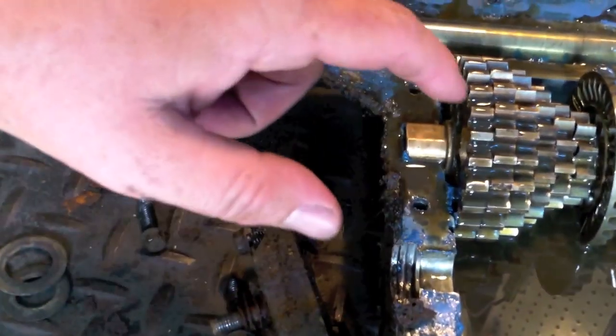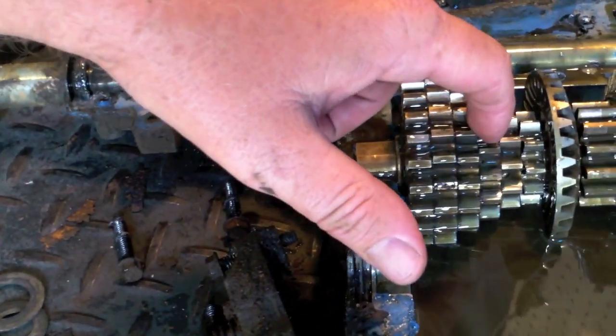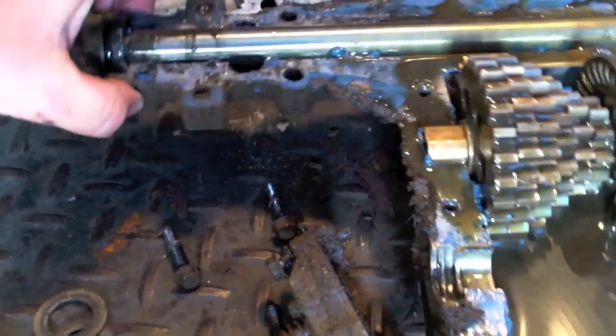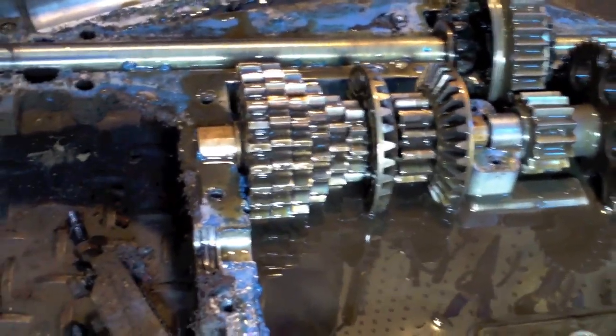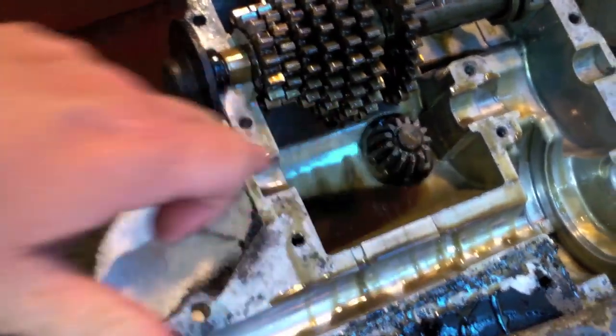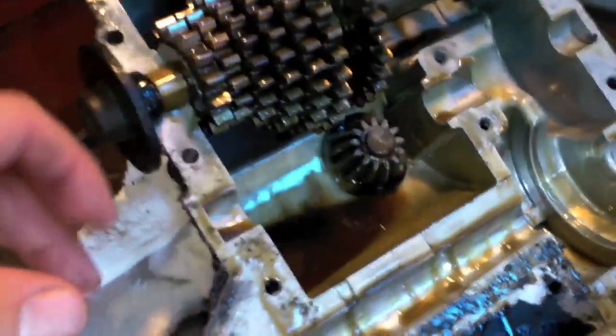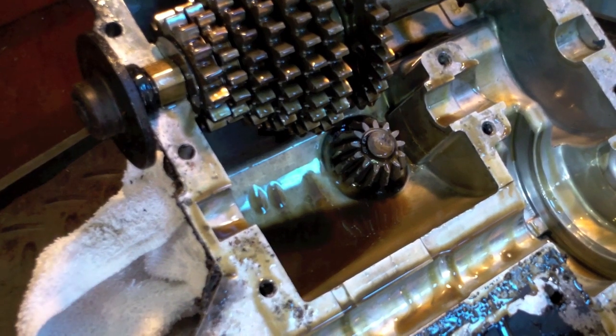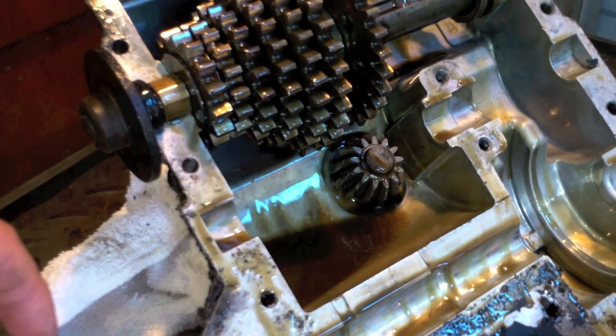And this is indeed 1, 2, 3, 4, 5, 6, a 6-speed, because that's critical, because the rear transaxle in the Murray Gator is a 6-speed as well. So I've got to have them all the same, because the 5 and 6 speeds are geared different. Y'all know that though. Alright guys, what we're going to do is change out this input shaft and see if I have some silicone. More to come.